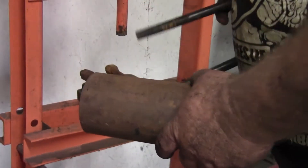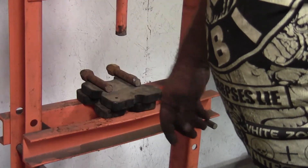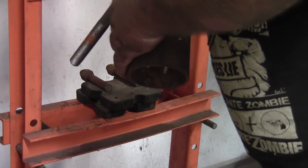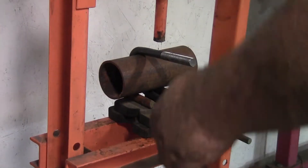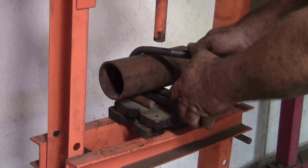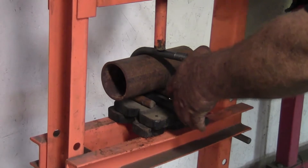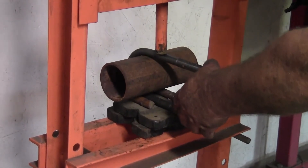When I originally took this truck apart that I got these trailing arms out of, I just chopped the U-bolts off with a torch at the time. I just put these other pieces of U-bolt underneath this piece of pipe to keep it from moving around. What we're going to have to do is get that piece of pipe in there and get this to fit back through that three-inch opening — or actually it's more than three inches because it's in there crooked. All we're doing is getting this where it'll fit around the axle and fit tight, and then be able to go back through the mounts. If you're going with a three and a half inch axle, it's only a quarter inch on each side — you can manipulate it to make it fit.